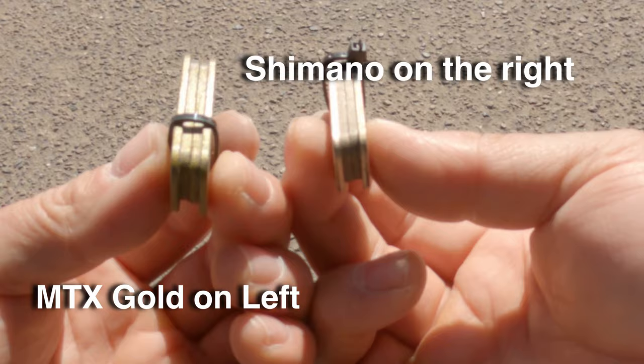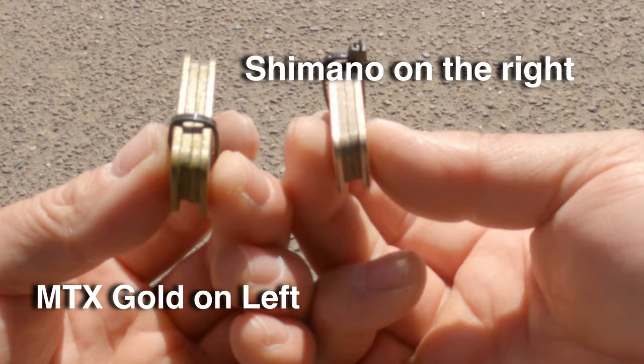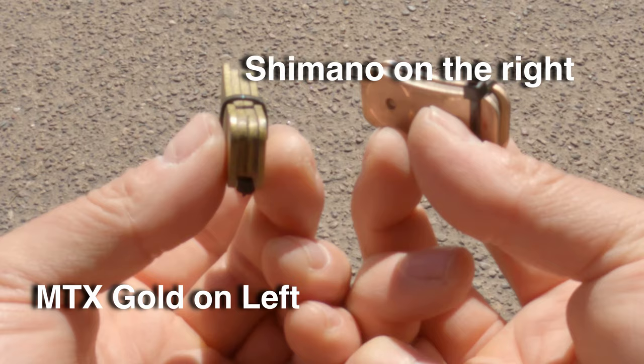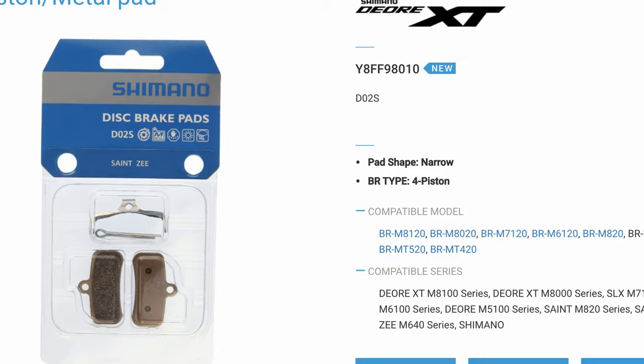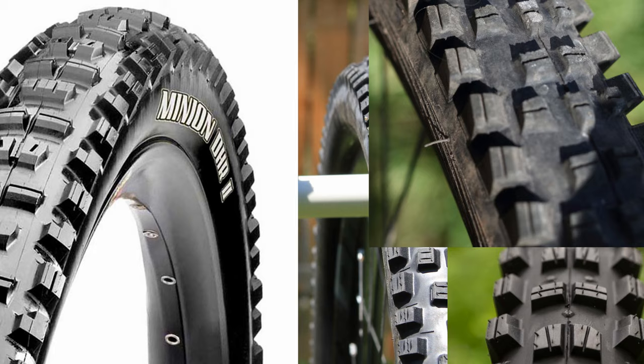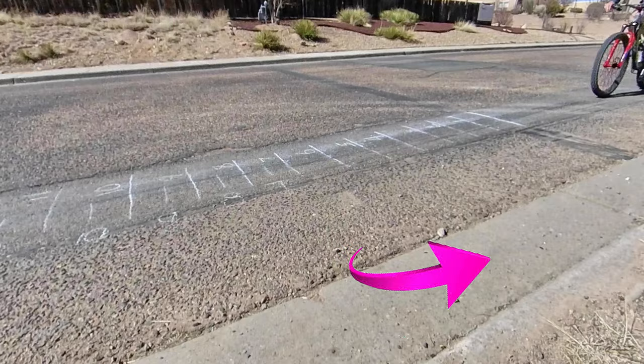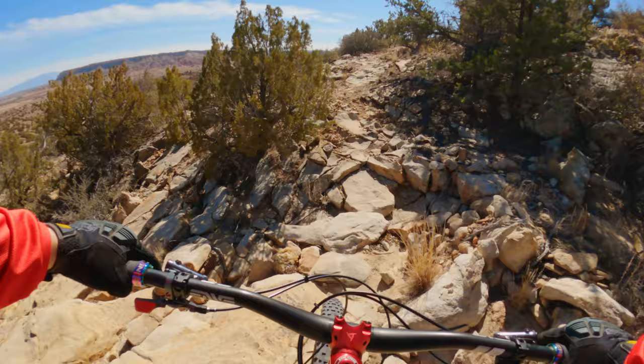Here's what I've settled on — a blended system. Up front I'm running the Shimano metallic pad with the 203 millimeter Galfer rotor for more bite. In the rear I'm running the MTX Gold pad for more modulation, because the Shimano metallic pad with the Galfer rotor in the rear is so powerful it just locks up the rear wheel. The MTX pad allows me to modulate that power without skidding in the dirt. Of course your tires would be the next step in improving braking power. If you've made it this long I hope you found this information helpful — please consider subscribing, hit that like button, and share the video if someone else could benefit. On the trail of life it doesn't get any easier, you just get better — so push forward as you travel the narrow trail.